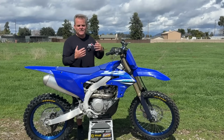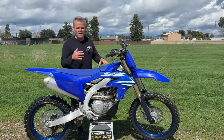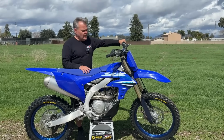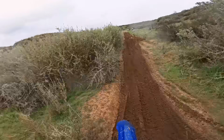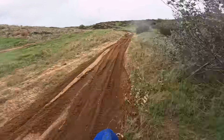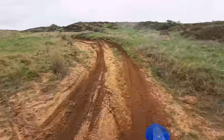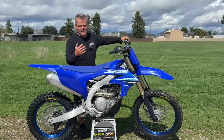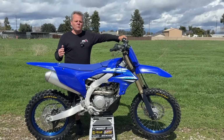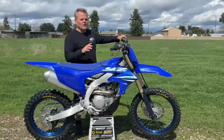I've talked to some guys that I really trust. Trevor Hunter, good guy out west here who rides a lot and races a lot of West Coast conditions. They go up to a 14/52, which makes it a little bit easier to ride, especially off the bottom. Not as gnarly of a hit off the bottom. And it helps the suspension to work better with that larger front, which is most of the KTM bikes run a 14 front. So stock is 13/50. We're probably going to try a 14/52 very shortly.